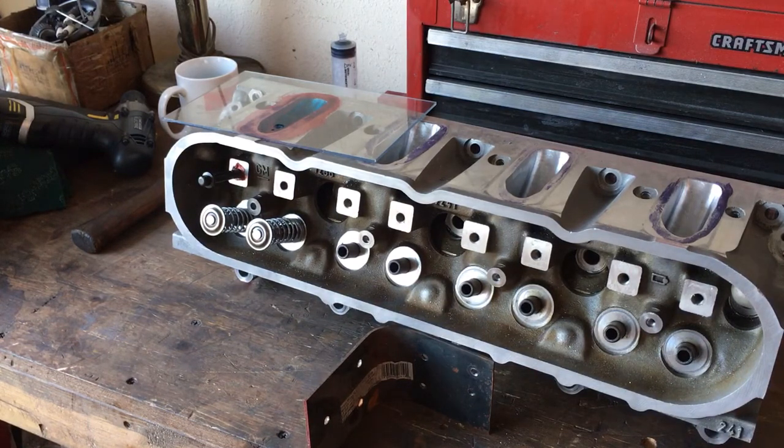The intake runner came out at 216 cc, a little bit shy of the 220 cc I was hoping for, but that still will be 275 and higher depending on your valve lift of your cam and all that, because it would still hit 280 and above.